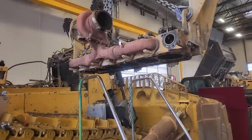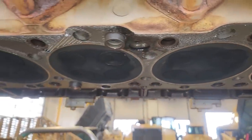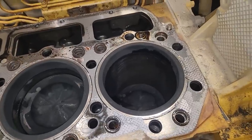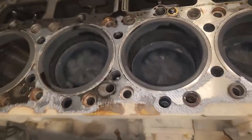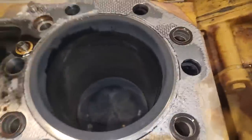We were able to get all the parts off and used the engine lifting brackets to lift the head off — pretty big brackets. It looks pretty good from what I could see underneath: no damage to the valves, though there is some carbon buildup — a little more than I was expecting on a not-so-old engine. Looking at the cylinders for signs of oil consumption, I was expecting to find something wrong with a cylinder pack — maybe a broken ring, bad crosshatch, or heavy glazing — but I don't actually see anything. There are a couple little lines, fairly normal, nothing you could even feel.